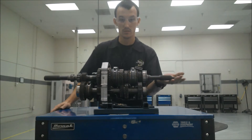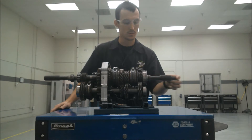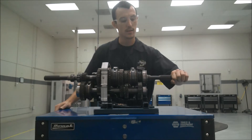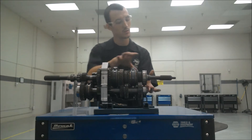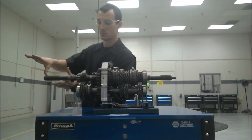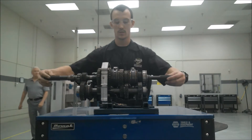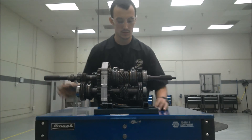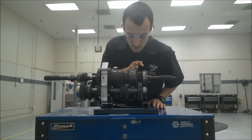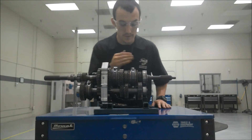The power is going to come in here — this is the input shaft. The easiest way to tell that is by this tip here; this small tip actually goes into the pilot bushing inside of the block. So this goes into the motor, and this drives the wheels. This is the output shaft. Now you might think these two shafts seem similar, maybe even the same shaft, but that is actually not true. There's a separation right here that separates this shaft from this shaft, with a bearing in there.